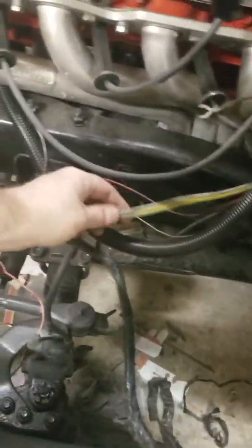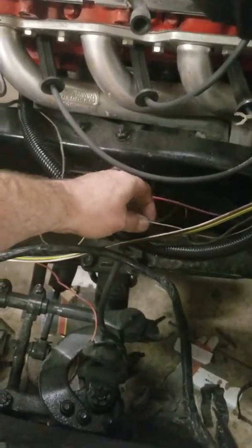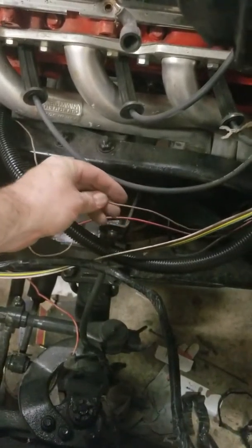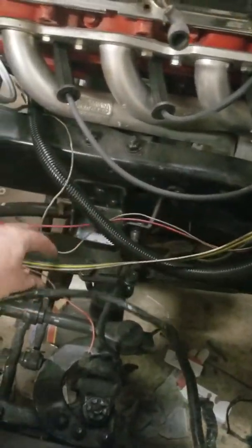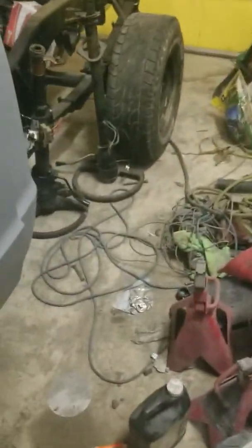I've done up my own wiring, made it from the back up to the front — just lengthened the fuel pump wire and the fuel gauge wire, then all new wiring. One thing I noticed is that GM had multiple connections going back to the rear and I don't know why they didn't just run one line.